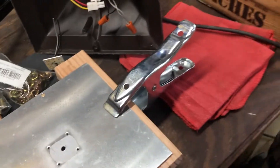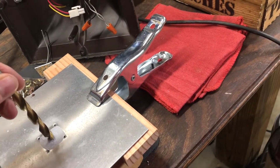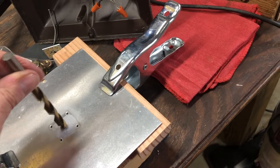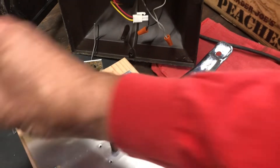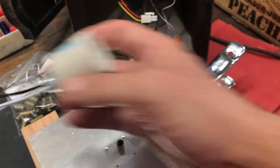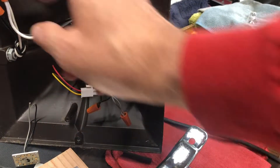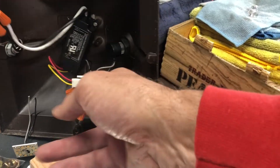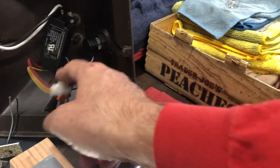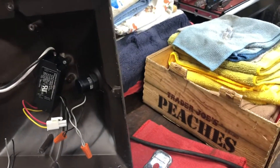Now I'm going to drill a hole. You need a 3/8 inch drill bit to go right in the middle, and drill a hole so you can insert that little lamp rod to connect to the light bulb holder and connect the wires. The next step is to remove the driver — it's back here — and cut all the wires except the feed coming from the AC power. All those other wires will be gone: the one connecting to the sensor, all of that.